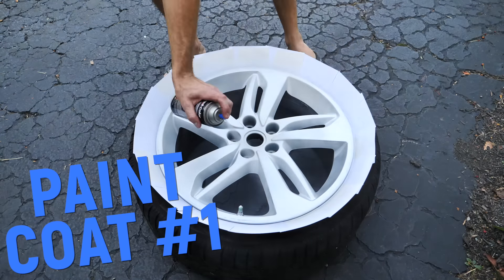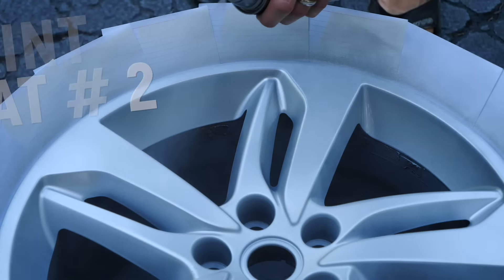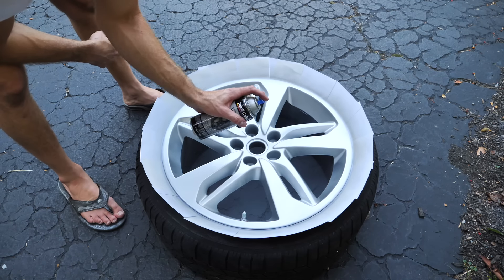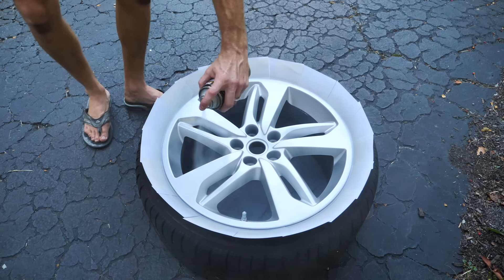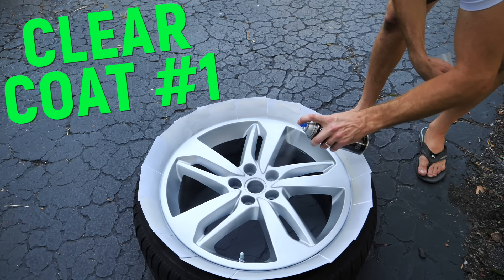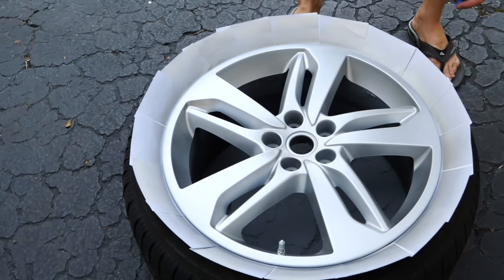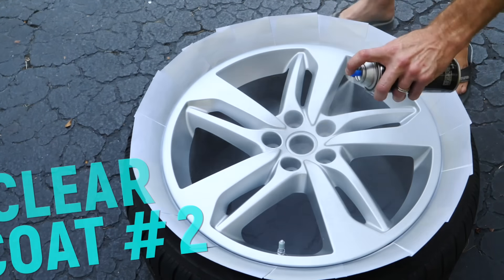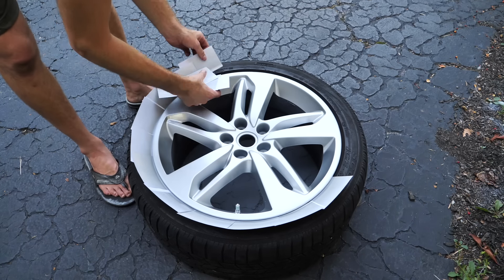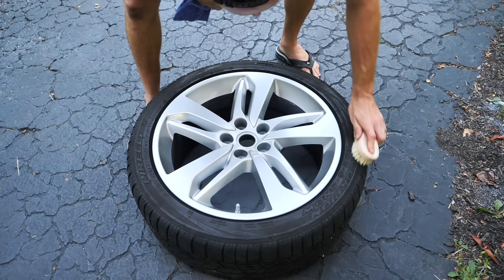For the paint stage, apply three total coats with 10 minutes between each coat. For the clear coat, you can use gloss or matte — just try to match what your other wheels have. I'm using the gloss clear coat and doing three coats as well. About 20 minutes after the final clear coat, remove all of the index cards, then use a bristle brush to lightly scrub the face of the wheel. You will get some overspray. Then wipe the surface completely with a microfiber towel.